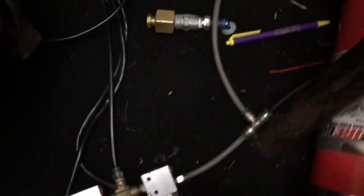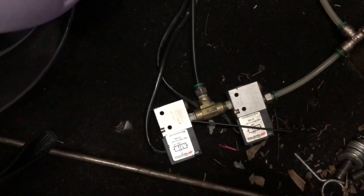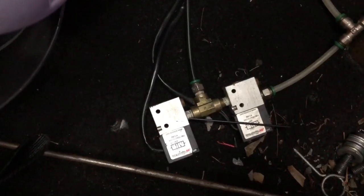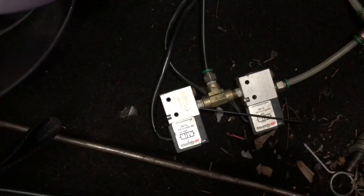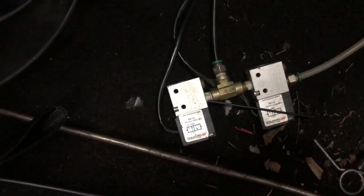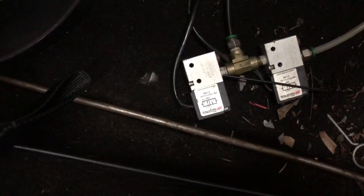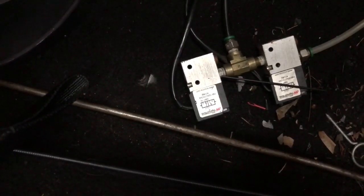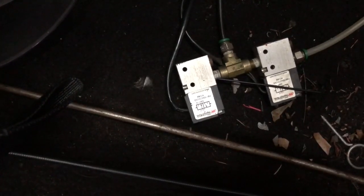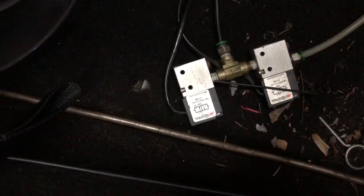Here are my solenoids. You see the T there — the black line goes back to the parachute. I have an air-controlled parachute; you still pull the lever like normal but the air solenoid pushes it out a lot faster and it's a little easier to pack. It comes down into the solenoid — regular 6JJ5-2 valves. The one on the right is the fill solenoid, you've got the T coming through in the middle, and the one on the left is the vent. Those work in conjunction together, and then the black line going out goes up to the front of the car and to the waste gates. When you have a preset pressure, the fill solenoid opens and progressively ramps up to the pressure you want. If it overpressurizes, the dump solenoid releases a little bit of pressure — you'll hear it clicking back and forth. That's how these work.